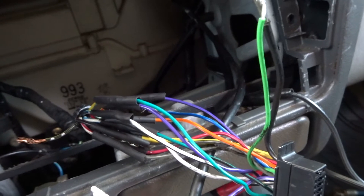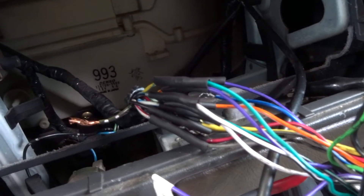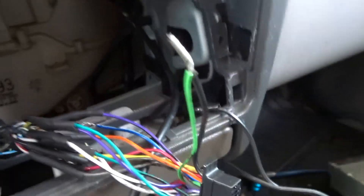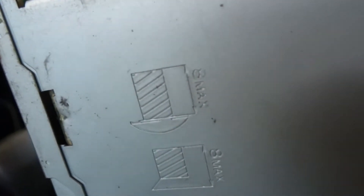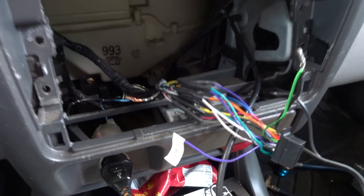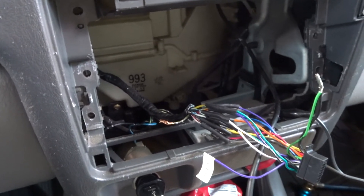These two wires right here — the ground and the green wire — the green wire is to unlock specific features they don't want you to access while driving, so it needs to be grounded to your emergency brake or you can just ground it out anywhere. I'm going to join it with the black wire and hook it to the back of the radio right underneath there, so it's grounded straight to the chassis of the car with no special process for unlocking the features.